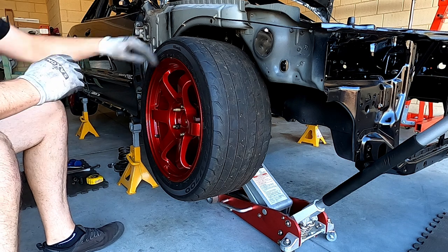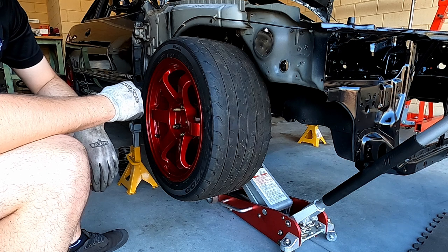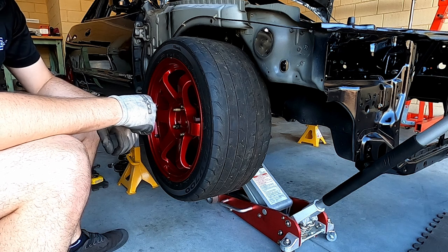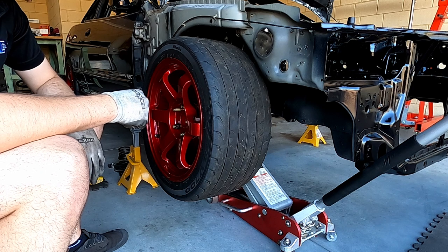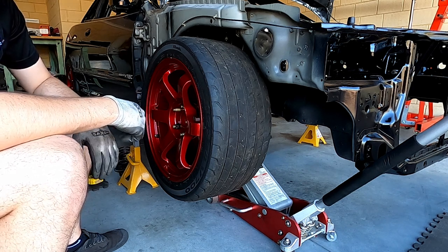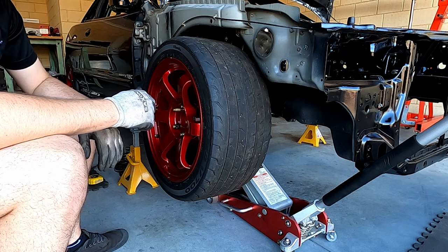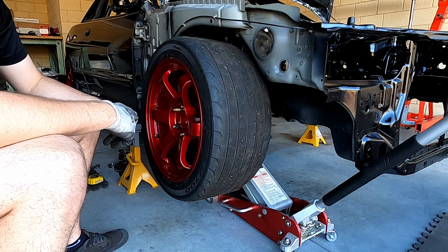Now I'm compromised trying to make sure the tyre doesn't rub on full lock. I just have to accept it's going to kind of touch at high lock on the inside when turning that direction. I've got clearance on the back side of it - I'll do some testing at the track to see how bad that really is in real life. It's close to full lock but not properly full lock, and it's not often that you're on full lock under full compression. When it drops to normal ride height there'll be a lot more room for the wheel to turn.